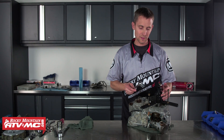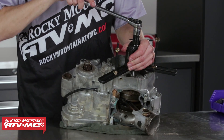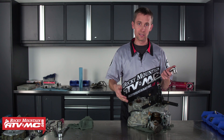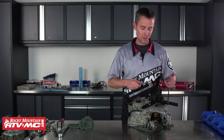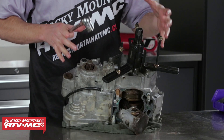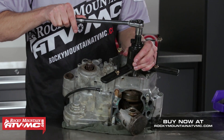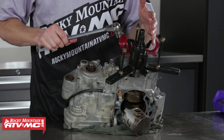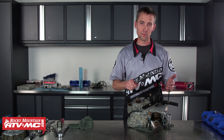I'm going to use a 17-millimeter socket or wrench on the tool and start tightening it. A lot of these cases, like this Yamaha case, don't use a center gasket — they're actually glued together pretty much, so the cases can stick pretty tight. You also have the bearing on the crank and even the bearing on your countershaft sticking a little bit. When a bike's been together for a long time, things stick together and you end up putting a lot of force on this. Be careful, because if you put too much force you could throw your crank out of whack — and you could also break the tool. This is really hard steel; it's not going to give much. It's going to break before it bends.